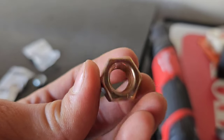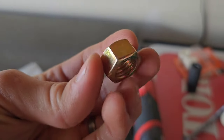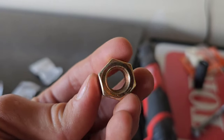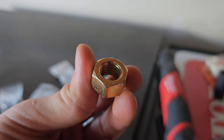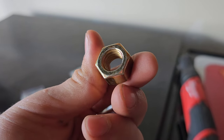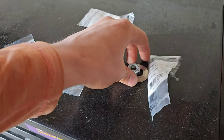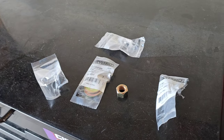Since it's just held on by one hex nut, make sure to keep an eye on them. Once a week, check the nut to make sure it's not loosening. If you see the ramp rocking back and forth, check the hex nuts. Grade eight nylon lock nuts would be awesome, but this is all I could find at Home Depot. Replace this nut as soon as possible — this cheap garbage needs to be replaced with a nice grade eight.